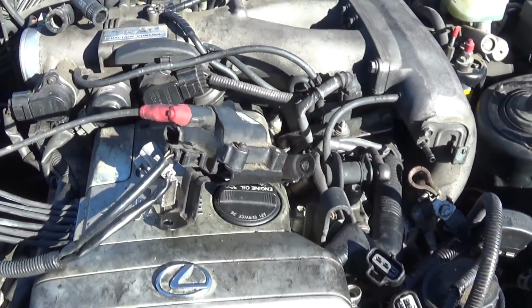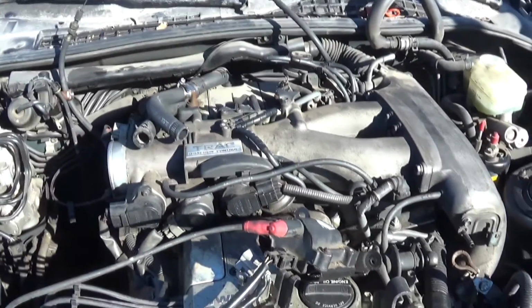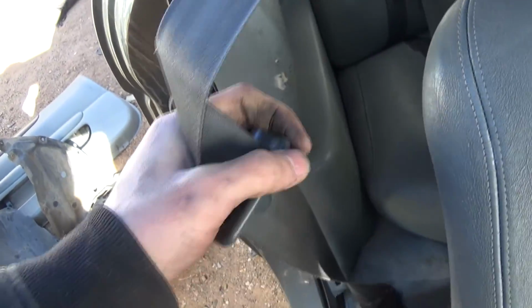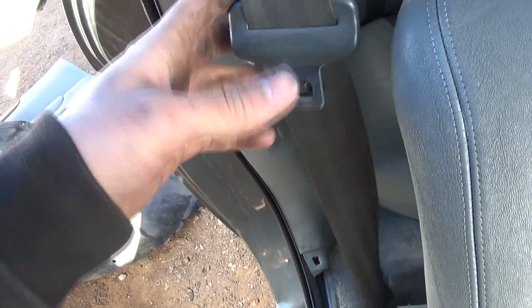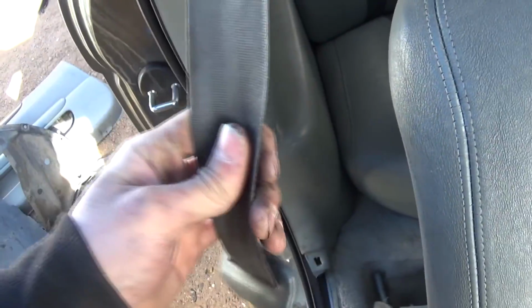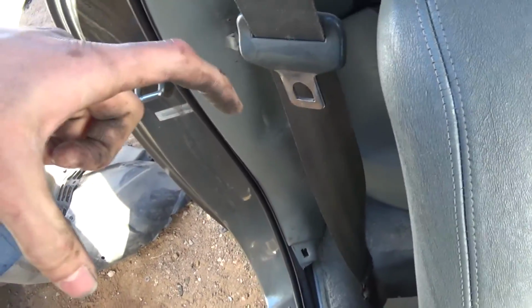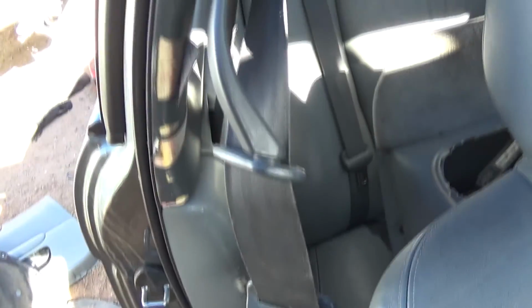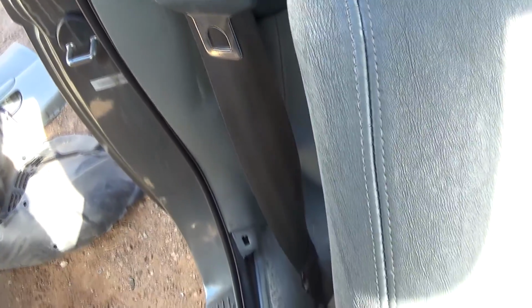Yeah, we're getting ready to get the hoist on it and just pull it and disconnect what's stuck as we go. So I'm gonna snag this seat belt. The A-frame hoist just has like one hook. So you gotta cut a seat belt and then use that to do your mounting points, and then get it with the A-frame. So I'm gonna go ahead and cut that off right now.